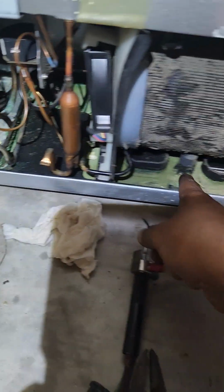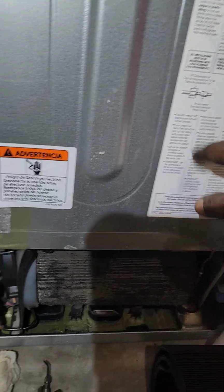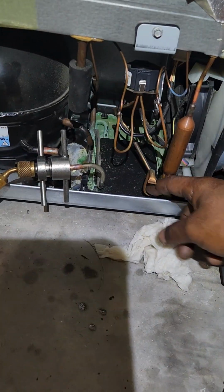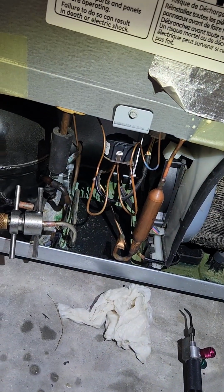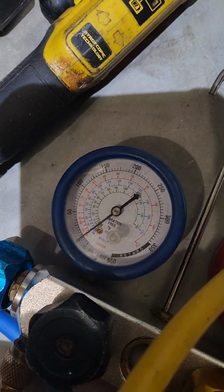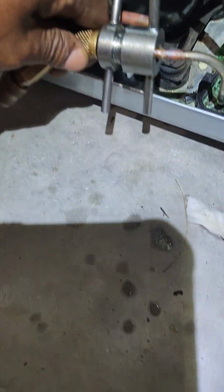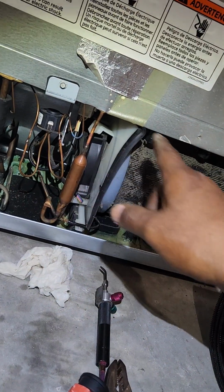Alright. Pressurized, it comes into the high side, to the drain loop, goes into the condenser, it comes out here, and then it goes through the pipe cluster. It comes back out into the three-way valve, and then out to both evaporators. And I'm not getting anything. No. Here is in the line. See? Going down. Let me put air back in. Yep, went right back up. So there's a hell of a restriction going on somewhere here on the high side.